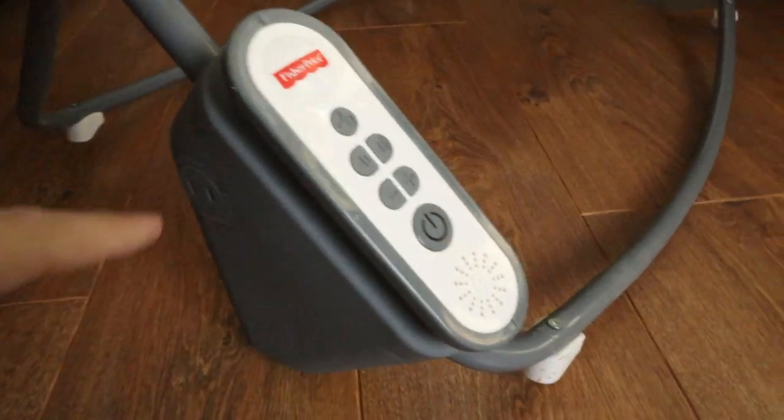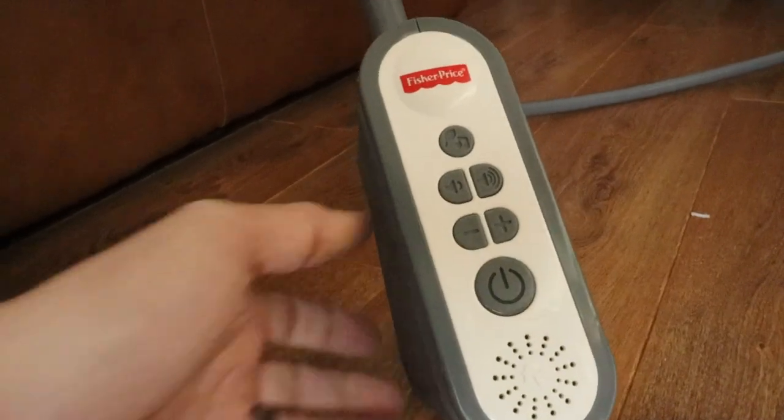So this is how this thing works. If you notice down here, there's a little foot and when it works, that little foot comes out and rocks this sucker up and down. But now when you turn it on, it doesn't do a thing. Full disclosure, I've actually already fixed this thing once before. There was a little gray band — think of it like a vacuum cleaner band that keeps the rollers moving. That's essentially how this thing was working, but it broke. I fixed it temporarily one night with a rubber band, but clearly it broke again. So let me show you how I'm going to fix this thing permanently. A lot of troubleshooting is just tearing it apart and trying to figure out what makes it work. So let's dive into this — I'm going to take it off and we'll see if we can figure out what's going on.